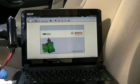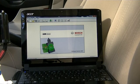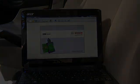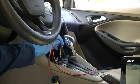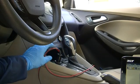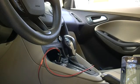Remember, normally the last step when using the CDR tool would be to apply power or turn on the ignition key. In this case, I have the software ready to go with case comments and I am ready to collect data. I'm going to plug the repowering device into an accessory receptacle in the center console, which has power all the time. Then I'm going to click the collect ACM data icon in the software.